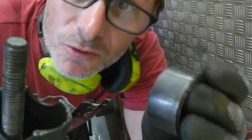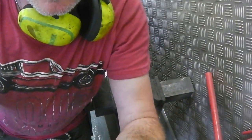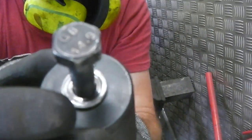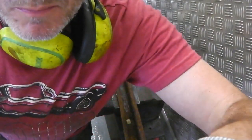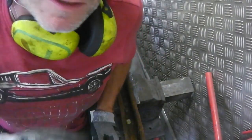Okay, bush extractor tool. You just saw us taking the arms off the axle, hoping you like that. Now, this device takes the bushes out. Most of the times these will work. Make sure you've been oiling up your axle well ahead of this operation. Use Plus Gas if you can, thanks to Paul for the Plus Gas.